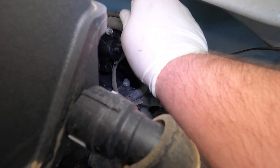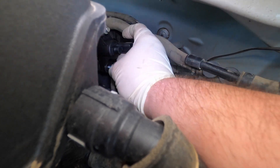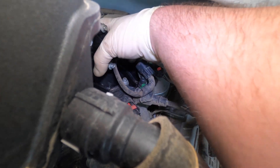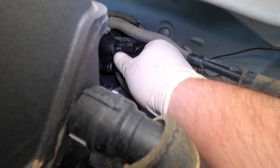We're going to put our 8mm bolts back in. You want to torque these very lightly - no ugga duggas - you don't want them very tight at all because it goes into plastic, like a riv-nut. Pop the connector on, make sure you push the lock back on, and get this sucker tight.